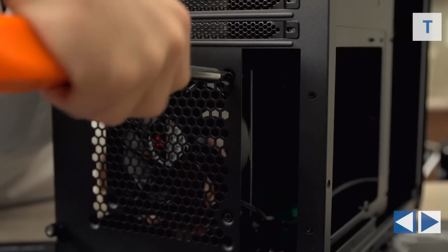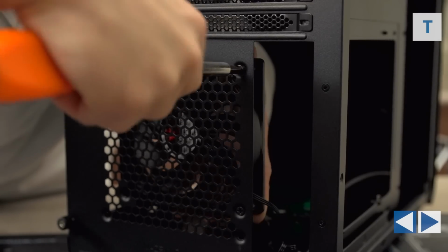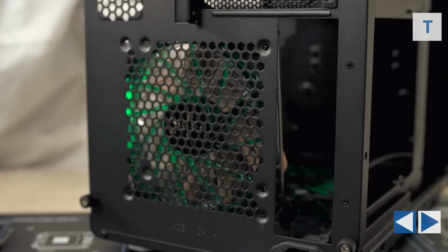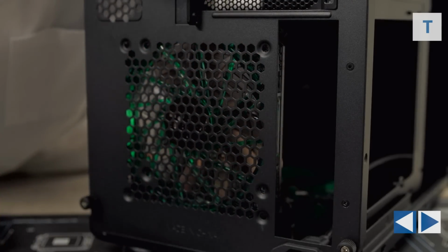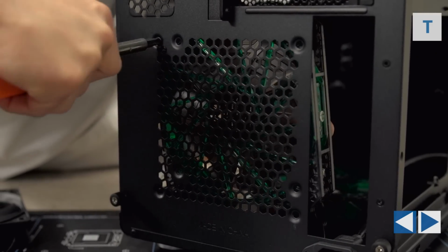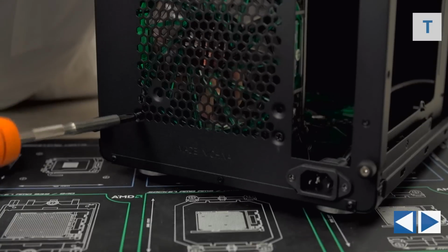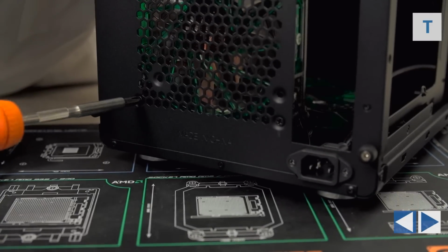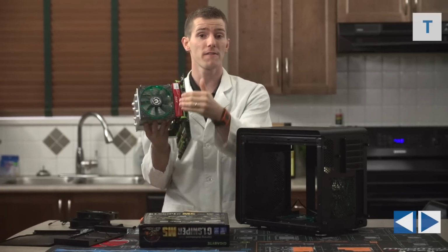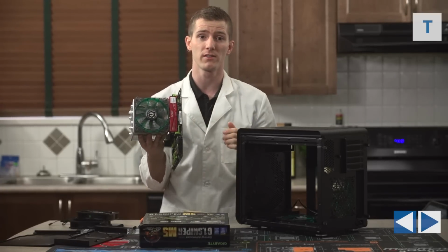We then repeat that same procedure for the rear fan, replacing it this time with a 140mm Spectre Pro just to get a little bit more airflow. Just a reminder here, guys, make sure you're checking your fan orientations as you're installing each of them. It's nice to have logos the right side up in the finished build, but it's even nicer to have short, easy to manage runs to the fan headers on your motherboard once everything's installed.